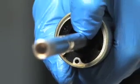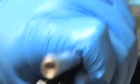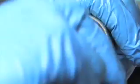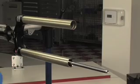Use your finger to press the air seal head into the upper tube. When you feel it break free, slide it into the upper tube about 3 mm. Remove the air assembly shaft guide retaining ring from the bottom of the left upper tube using internal snap ring pliers. Pull out the air shaft to remove the air spring assembly and shaft guide from the upper tube. Spray isopropyl alcohol on the inside and outside of the upper tube and wipe with a clean rag. Wrap a clean rag around a long dowel and insert it into the upper tube to clean the inside of the tube. Inspect for debris or damage to the tube's inner surface.